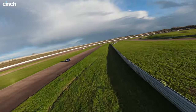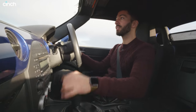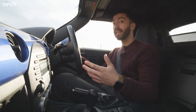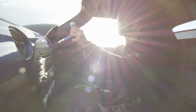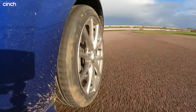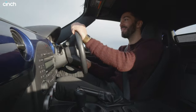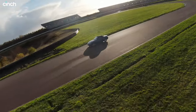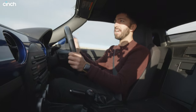Now we're doing things in reverse because there's a massive rain cloud on its way, so we want the test circumstances to be the same. I'm now in the car with the correct tyre pressures — 29 PSI — out on the drying circuit. There's really good grip. It's not surprising; these are the correct pressures. Let me try to aggravate the car through this turn and see how it acts with a bit of oversteer. Yeah, really nice and composed — a nice slide and you can feel the tyres biting into the ground, doing their job. On the greasy stuff it begins to slide but it's progressive. These Davanti tyres work quite well with this MX-5. You can do a little slide if you want but it's very easy to bring the car back into line. Correct pressures feel right.